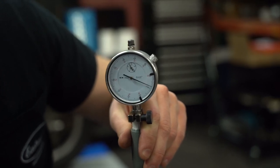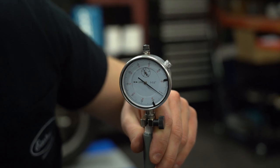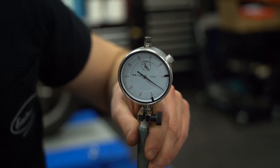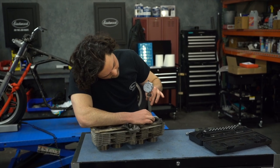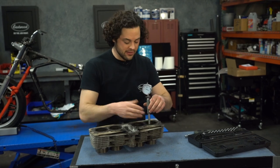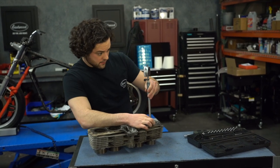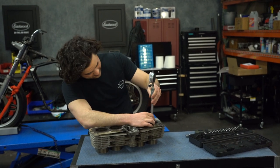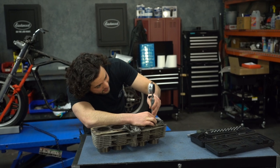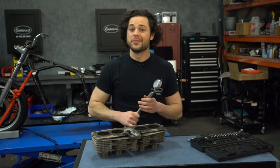The top has a little bit of carbon buildup there. This way is going to be tighter, or this way is going to be loosening. Moving down, you can see that loosens up a little bit. There's the middle right there — spot on. Let's hit the bottom — spot on. Perfect. Honda build quality, right? So that cylinder looks good. At this point you'd write down your measurements. Do a 90-degree turn — maybe take measurements from that direction as well. Top looks good, spot on, spot on. Wow — 42 years later, exactly in spec. So write that down and then continue for the other three cylinders.